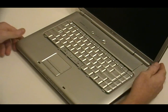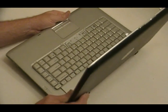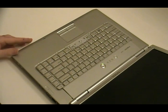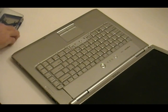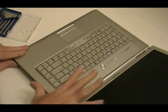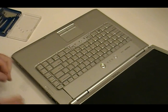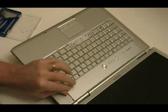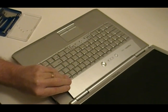Old habits die hard — as an extra precaution, after I pull out the battery I'll hold down the power button and discharge it for a couple of seconds, because some of the discrete components in a laptop can actually hold a charge for a while. I've already pulled the keyboard out of this. The process is pretty simple with the Dells — all you really need is a small flat-head and a small Phillips screwdriver. Bring the monitor down as far as it'll go, then start from this side of the bezel and pop it out. You'll see a little notch here — that's where you start.